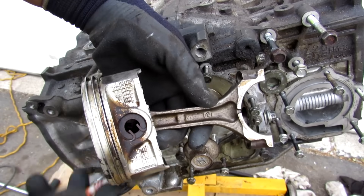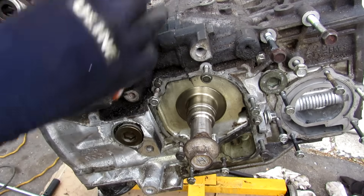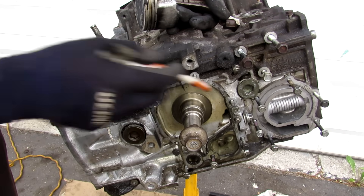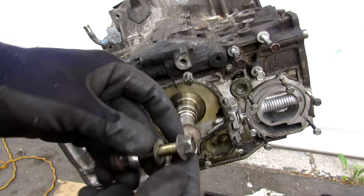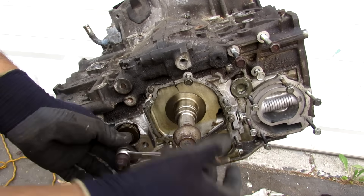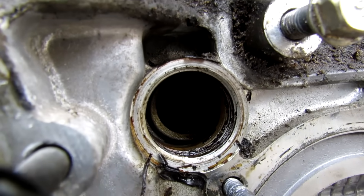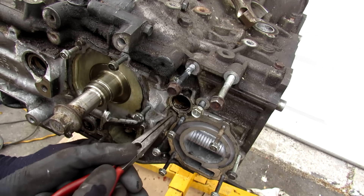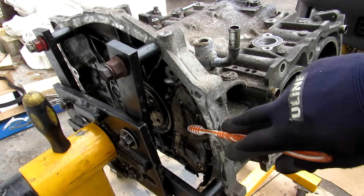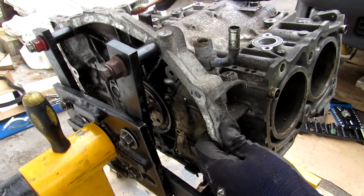This engine is pretty unusual, and what's even more unique is that we need to remove the connecting rod pin to get the piston heads off the connecting rod in order to split the block and take out the crankshaft. To access the connecting rod pin you need to open up the access ports — it's a 14mm hex. If you haven't got a 14mm hex you can take a 14mm head bolt, thread two nuts on the back, and put a wrench in the middle as a makeshift tool. Insert it into the port, loosen the plug, and turn the crank to align the piston with the hole. Reach in with pliers and pull out the pin — you'd need to either push it from the other side or use a special hook tool. To access the holes on the other side I'll need to remove the engine from its engine stand.